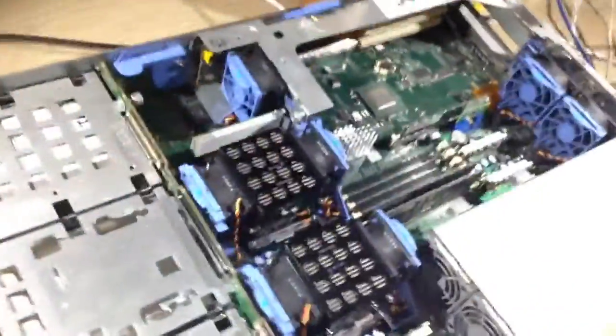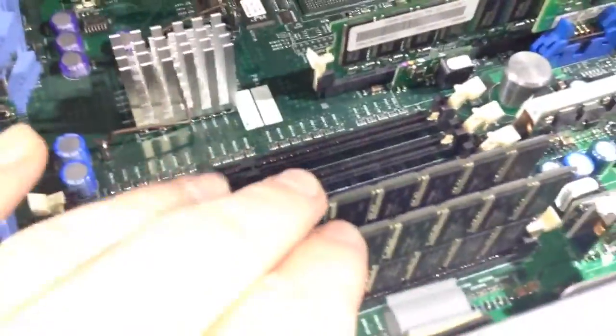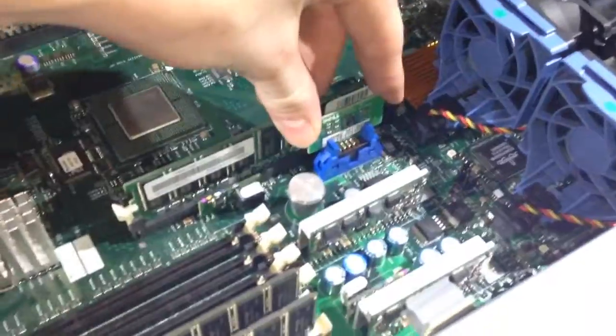The bottom lid isn't too bad but the top lid can be quite an effort to get off and back on. Here we go — so inside: CPU heat sinks, two CPUs, two gigs of DDR ECC RAM, hot-swappable fans at the rear, a hot-swap fan for cooling the PCI slots, and a push-and-pull system for cooling both heat sinks. There's also the power supply fans, voltage regulators on each side, the RAID key for the onboard RAID controller, and the RAID memory.